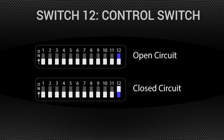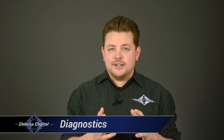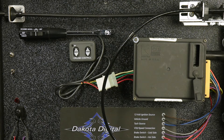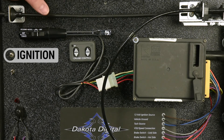There are two types of control switches for this cruise module: HND1 and HND3 are normally closed switches, while HND2 is normally open. With everything set up but before you take a test drive, run through the diagnostic process to ensure all connections and settings are correct. To put the cruise into self-diagnostic mode and ensure it's receiving basic signals — including power, ground, vehicle speed, and input from the control switch — turn your control switch off and the vehicle ignition off.